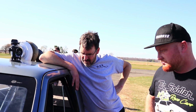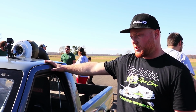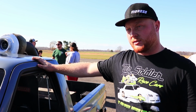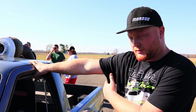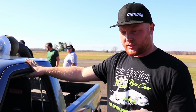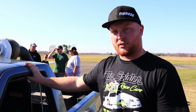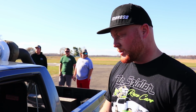So, she's probably going to go straight up. Conservative. Actually, I tightened the front end more. I tightened the front end last pass and turned the launch up a little bit, and it spun off the hip, but I think I just need to leave the launch the same and just keep tightening the front end until it doesn't bounce up. And then once I get it to stick good where I want it, then I'll start turning the launch up a little bit as I go. I need to quit changing so much at once.